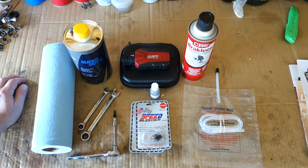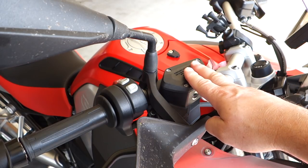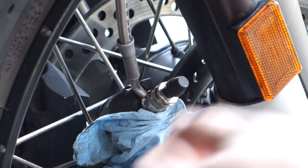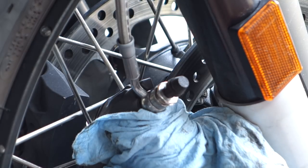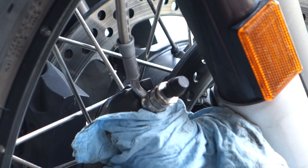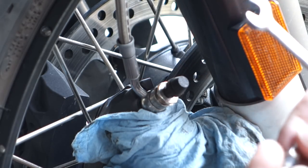I also wanted to mention that I'm going to be keeping the front brake reservoir cap on when I change out the bleeder valves, that way it should prevent a lot of brake fluid from coming out when replacing them. I've put a rag here so I don't make a mess, and I've got some brake cleaner in case it starts dripping. From what I've seen in other videos, it didn't really spill out too much — it doesn't gush out when you remove the factory-installed bleeder valve.